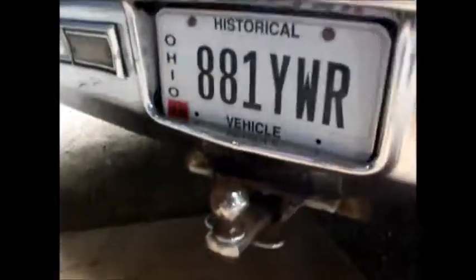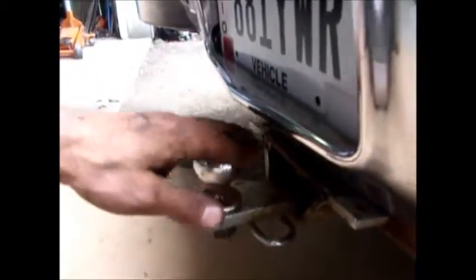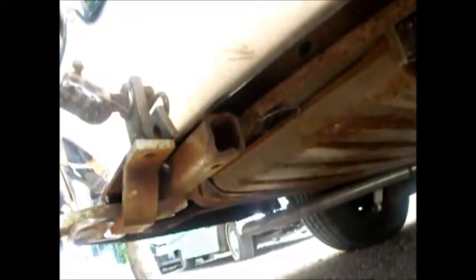I got the one hole drilled and the bolt nut in there. You can see how close the hitch is — what I was talking about getting my receiver or my tongue over that, and my no edge to this bumper here that these bolt holes would have worked on. And then there's that crossmember. I've got a piece of angle iron — I'm going to put it on the back side of the hitch, weld it to this, and then drill up through three spots and bolt that. That will give me my tongue weight mounting point. I'm going to take these pieces of thick wall tubing, cut them off at an angle, angle forward, and meet up with one of them holes in the frame, then bolt it out there through the tubing.